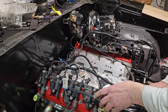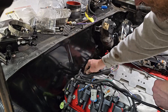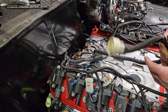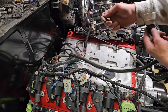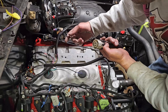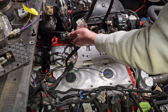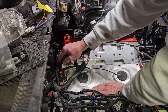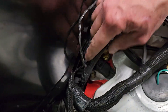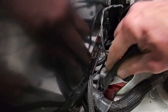Moving right along — when I said the wiring harness is not so scary, it's really really easy to lay this stuff out to the point where it just makes sense. This is our transmission plug, and this one is going to get a 4L60, so it only has one speed sensor wiring. Our transmission plug is all by itself so we can fish it down along where the transmission is going to get hooked up.